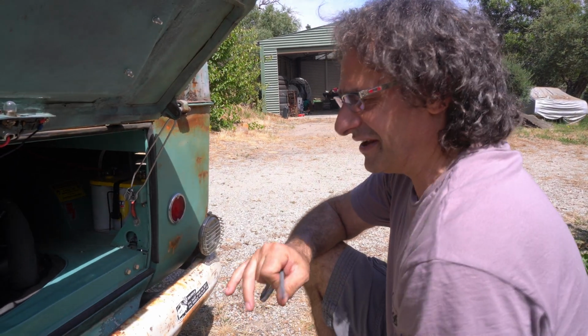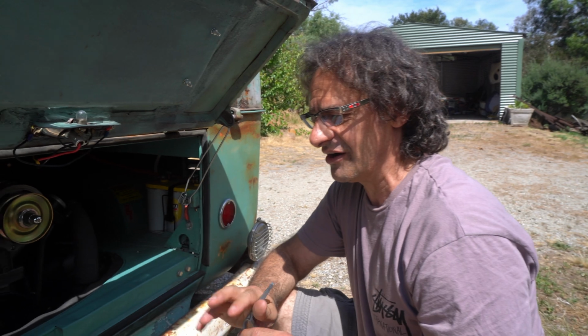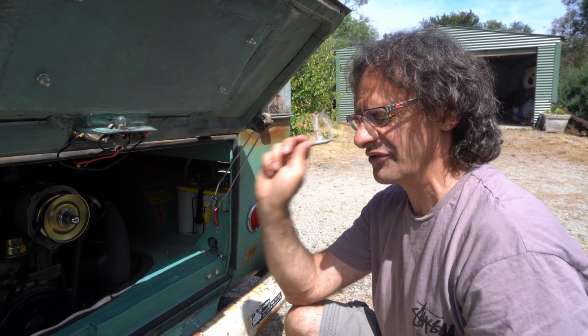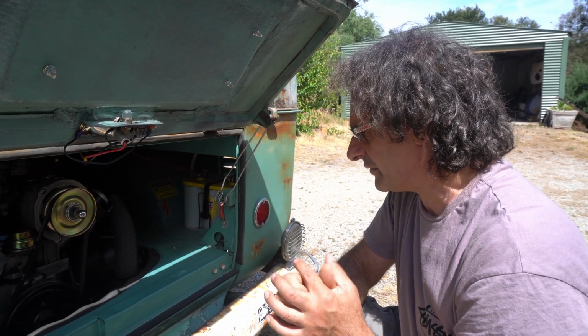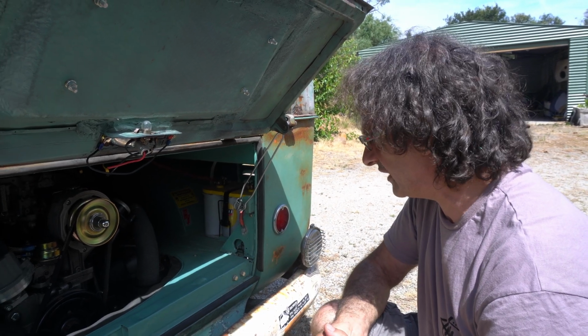The only downside at the moment, the gearbox, I didn't do anything to, and I was hoping, and I popped it in, and we went driving, and of course now it's popping out of fourth gear. So I've got a new gearbox coming from a mate of mine, so that once that's here, we can do a quick swap over and get a brand new gearbox in there.